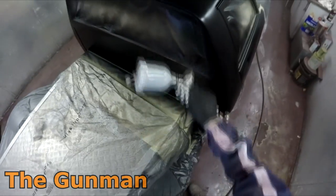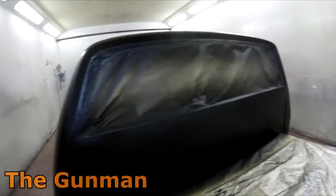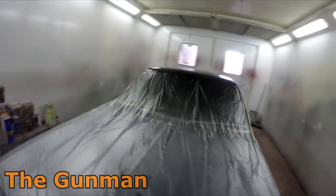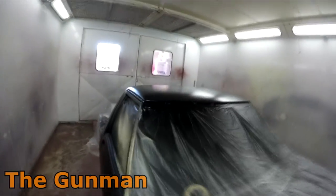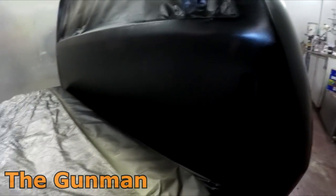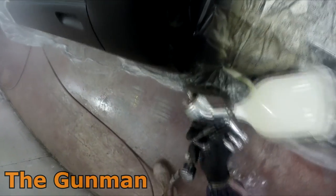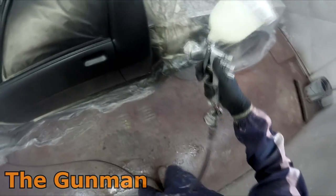The GTI was always around the $500 mark give or take. I believe the T2 was the best and most user-friendly — anyone could jump behind one of them. It's a conventional air cap — it's not HVLP, it's not LVLP. So on a smaller compressor you might want to look elsewhere, but most compressors will be able to keep up with a conventional spray gun, so for at home it'll be perfect.